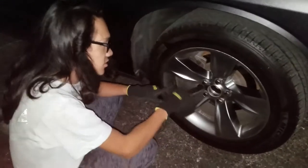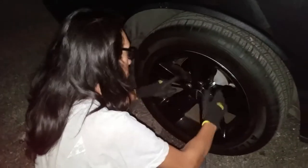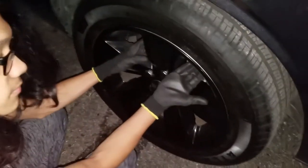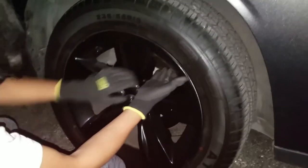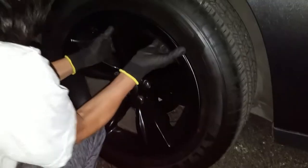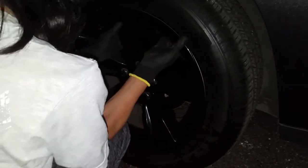Rim caps. As you can see, I already removed one. You have to, specifically on this Challenger five-spoke style, pick the five spokes. There's a little hook on this side, right here. You want to preferably get this corner first, but that's a very uncomfortable angle to work at. So get the direct opposite and just hook your fingers around or work around like that.